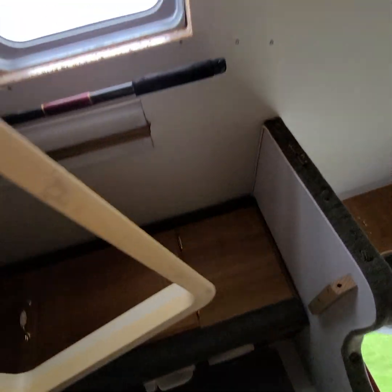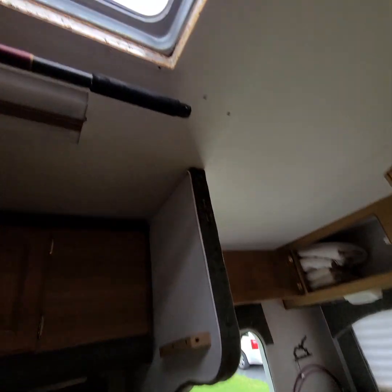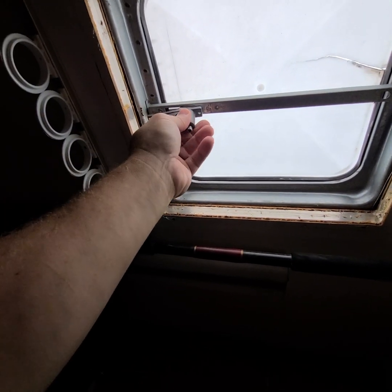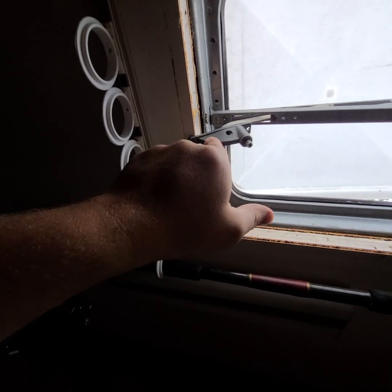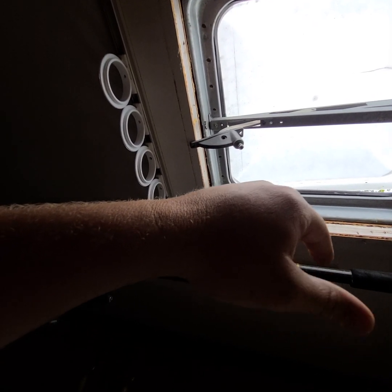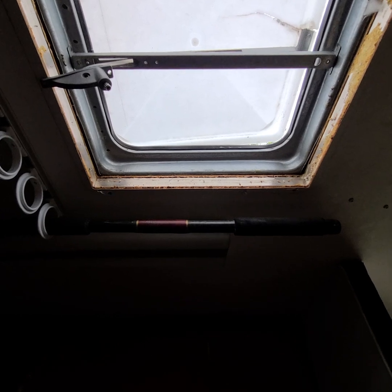And then you guys, before you take the screen out, you've got to remove these 4 screws. You can see right there, and right there. There are 4 self-tapping screws screwed into the framing here. And then you've got to undo the gear mechanism. There are just 2 screws to hold that in. So I'm gonna go up there and replace that, and I'll be right back.